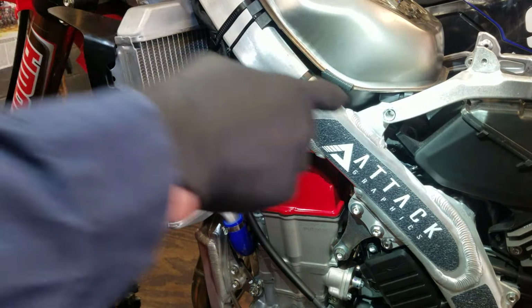When you put this on, there is a top and a bottom. Yeah, see that? That goes on the bottom. Interesting enough, I'm noticing this shock gives. Okay, no, that's not it. This is the groove right here. It looks like that top one right there could be a second groove to put this clip in, but it's not nearly as deep as this one. So it's going to be the second one, obviously. There we go.